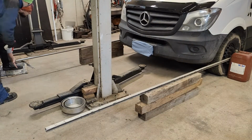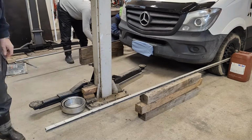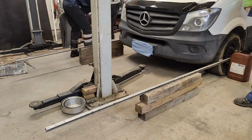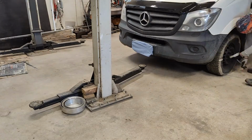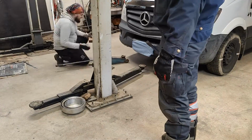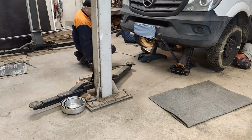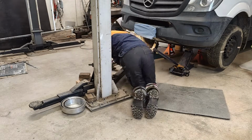Because we don't have any fancy wheel angle adjustment tools available right now, we created a similar kind of setup ourselves. The purpose of these linear beams and laser measurements is to keep the wheel alignment approximately the same as it originally is. This precision is good enough right now, and we can check the wheel angles and get them corrected later at another workshop. The preparations are almost done, so it's time to have a look at this mechanical puzzle a little bit closer.